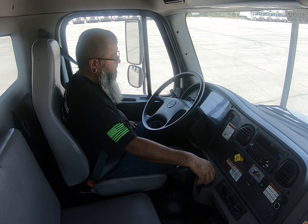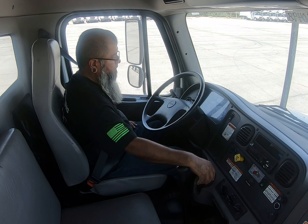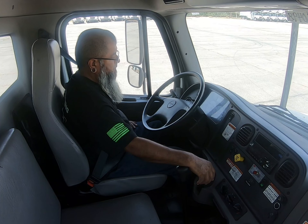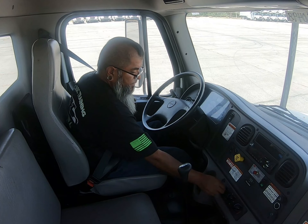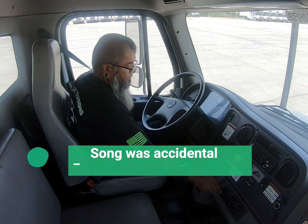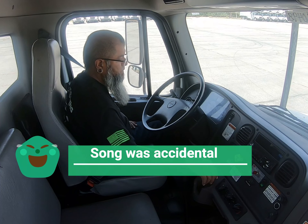The truck tanks are full so I'm going to pump it down under 100 PSI, preferably at 75, and go ahead and jump into my cutout test. I'm going to rev the engine between 1,100 and 1,500 RPMs and then wait for the cutout.